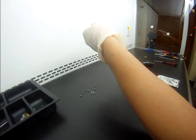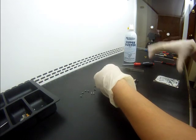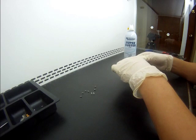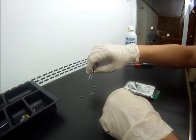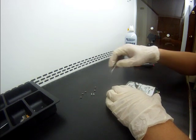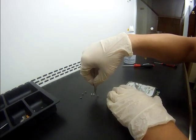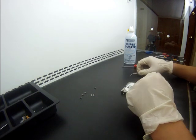I always open up drives that had been previously opened before powering them on, because we need to know the state of the platters. If the platters are scratched, or if you notice something unusual on the inside — like the heads sitting crooked or one of the heads ripped off from the actuator arm — you don't want to power on the drive like that.